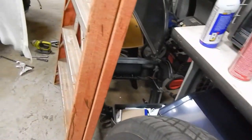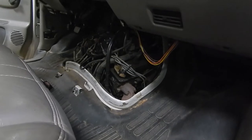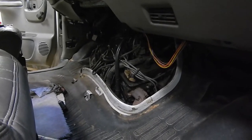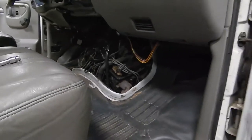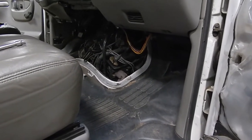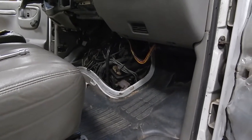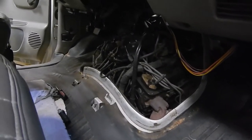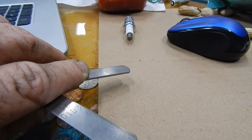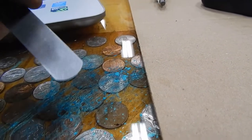Hopefully this stuff will go back on pretty good. Plug wires hopefully will go on without too much trouble — they're going to be aggravating but I won't have too many issues. I want to get the plugs in tonight. I'll put a little dielectric grease on the boots — not much, just a little bit — so the boots won't lock up, and some anti-seize on the spark plug threads so they won't seize in. With 100,000-mile plugs you're not changing them every 12,000 miles anymore, so keep them from freezing in. These plugs are gapped at 60 thousandths — I've got a 15, a 20, and a 25 feeler gauge, which will make 60.